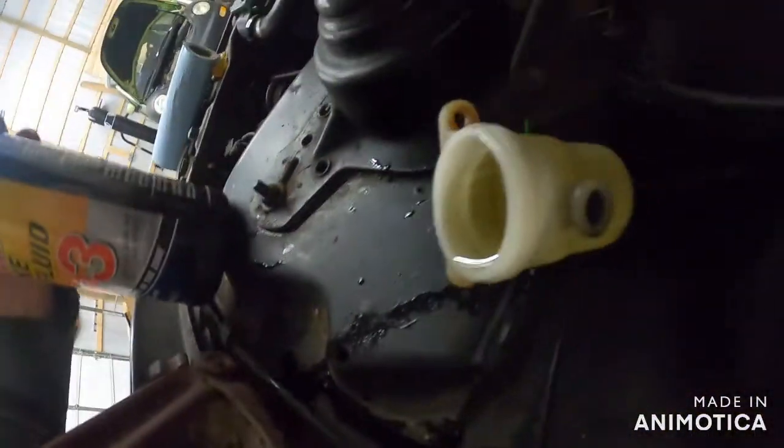The good thing is it's only me and this sucker is chugging brake fluid like an Irishman at a free all-you-can-drink fest. By the time I squeeze my fat behind out from underneath this car to up top, she's already chugged a little reservoir's worth of fluid — they gave it a shot glass full worth of reservoir. So I'm going to continue to let it gravity feed, actually mount it, see how the pedal feels inside, and we'll go from there.